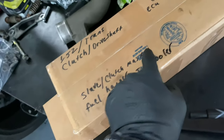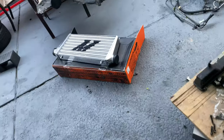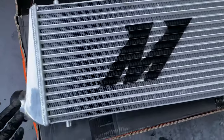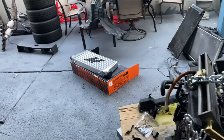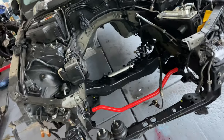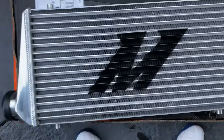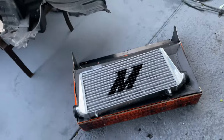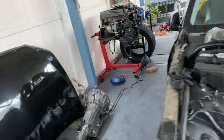Intercooler — you're going to need a fat front mount. You can be like me and bowl out and get a Mishimoto M-line. Honestly, the only reason I got this was because I saw BT Bobby with an M-line on his IS and I thought that was the sexiest thing ever. You can go with a budget CX Racing intercooler, but why would you do that? This intercooler is about $250. It's not the cheapest, but you want to keep the 1J cool and you want to keep that turbo cool — I wouldn't cheap out on an intercooler.